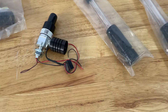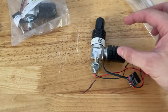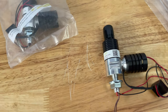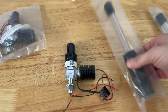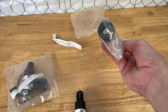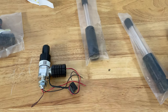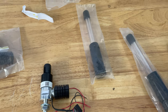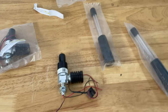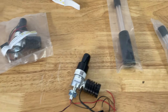I love the light that they put out. This is an optional base that has an integrated brake light in the bottom of it. So normal quick lights are just this part, and it has one big LED that shines up, and that's it. All the whips, these short little stubby whips, are just fiber optic. There's no electronics in these at all. So that light just shines through that hole and illuminates the whole whip. They're beautiful. It's real consistent. It's indirect lighting, so you don't have that bright LED shining right in your face, except for this brake light, which is a real nice bright LED.